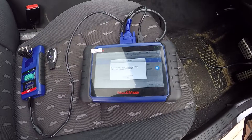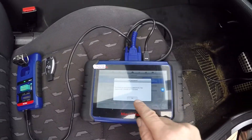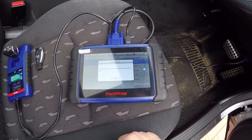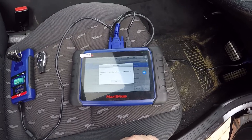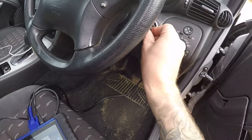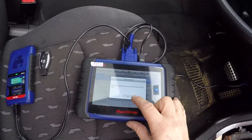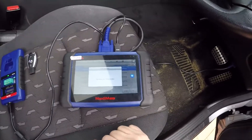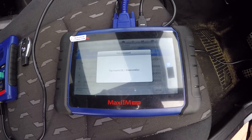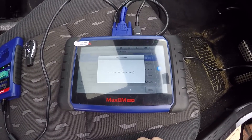The calculation is done - today it took about five minutes. Press okay, then take the ignition key into the EIS: take it out of the XP, into the ignition. I can hear the steering lock come off. Press okay and it'll count down from 30.